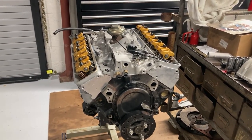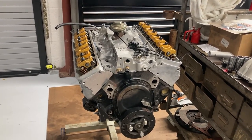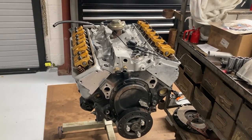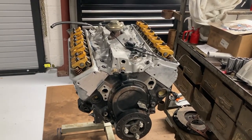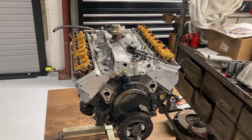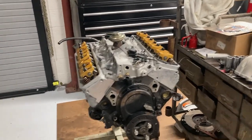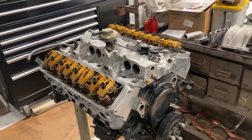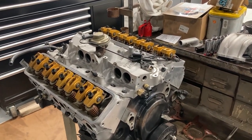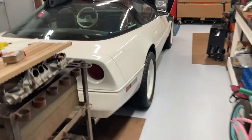As a reference, the Callaway twin turbo running about 18 pounds of boost with a big tube runner setup is about a thousand foot-pounds of torque to the ground — you're in a 600 horsepower range but damn near double on torque. They're crazy. If you learn how to utilize that torque and keep the gearing right and drive the car right in that RPM range, they are very fast. This has always been a very fast car for many many years.